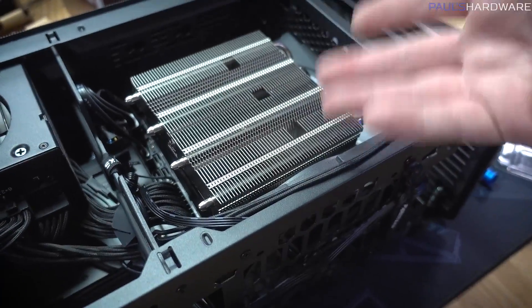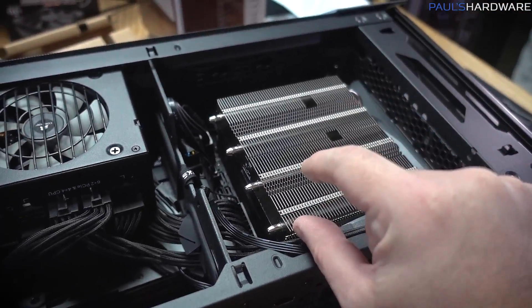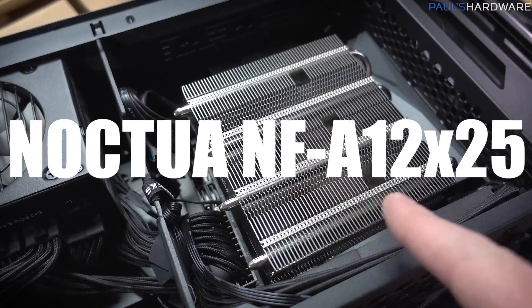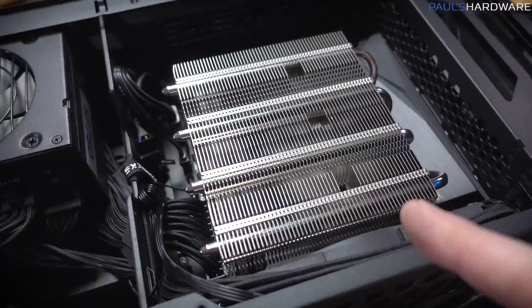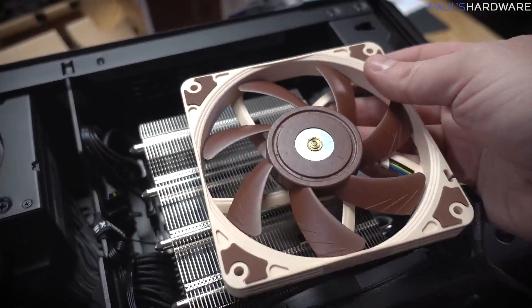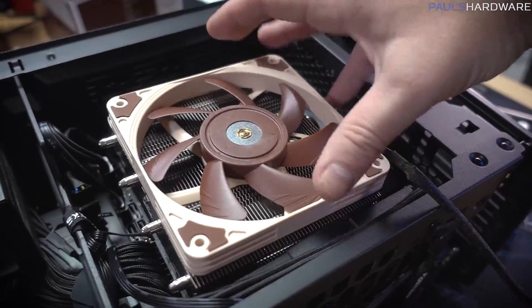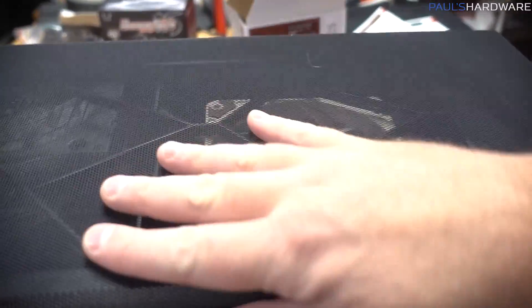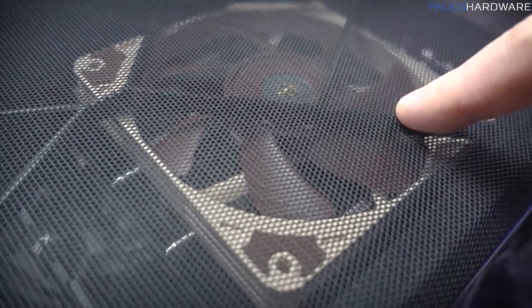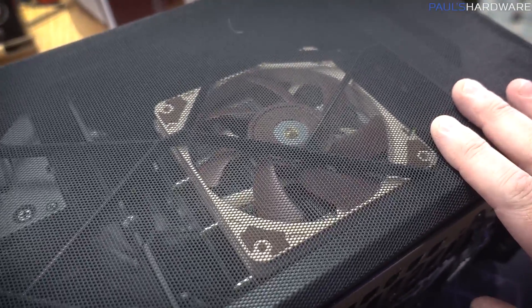I want the fan attached here, and I was thinking there might be enough space for a full 25-millimeter fan like an NF-A12x25, but our clearance is already getting pretty close. The fan it comes with is under-mounted for a slimmer solution, though that definitely requires shorter RAM. If I position it to intake right up against the side panel, and if the side panel fits, there'll be minimal clearance — but the mesh spacers provide a little gap as well. That should get tons of fresh air in there, so I think this is the configuration I'm going to go with.